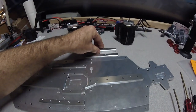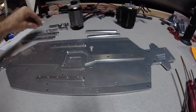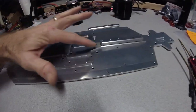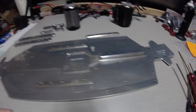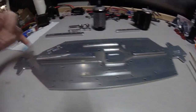What's really trick is he's got these different stiffening bars — these are six millimeter here. So you can either use six or nine millimeter, and with a nine millimeter you bring the total thickness between this piece, the chassis, to around 17 millimeters. It's really ingenious. I like having a little more flex in my rig, so I'm going to go ahead and test this with the six millimeter option.